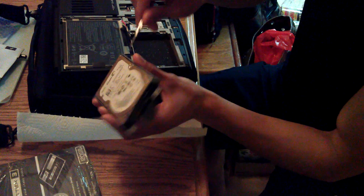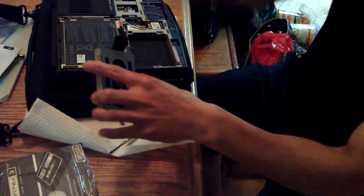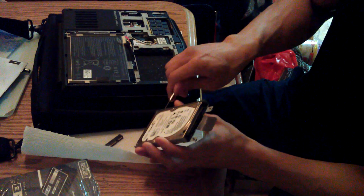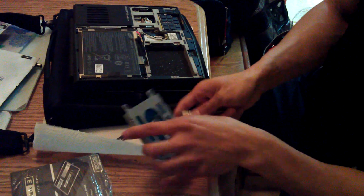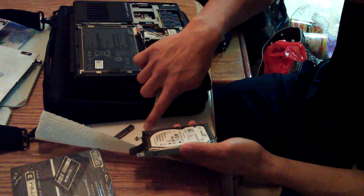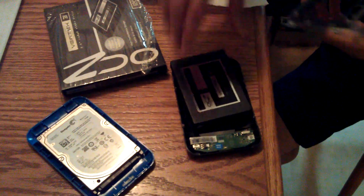This is a hard drive, and this is my friend's hard drive that came with his Alienware. There are another four screws here — just take it right off. Actually, pull off the connector first. The connector just pulls straight out. Do not pull up or anything, and try not to touch the connecting pins as this may screw things up. So just take that off, then unscrew these four screws. Put that connector back onto your new drive. Do not let it touch anything that has a static charge buildup on it, as that may damage it.